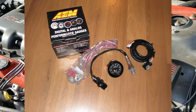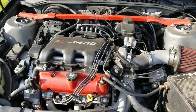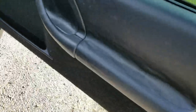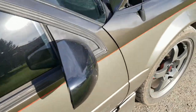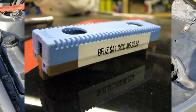It has the factory O2 and then a wideband O2 on the headers — that's how I ended up tuning this thing. It's OBD1 still, the 7730 ECM — the factory ECM that came with it. I'm running the 92 B-fuzz bin — that was the name of the bin. I used to have the computer hanging out here because that's the easy way to get to the chips, but I just started putting all this stuff back together. The B-fuzz was a 92 3.1 five-speed tune — that's what this is based off of. I bought a chip from a guy.